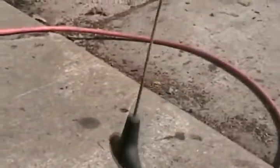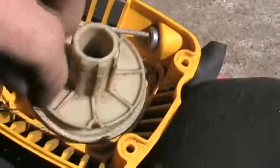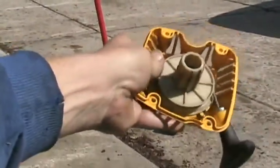Well, if it didn't wind itself back in far enough, grab a little bit more out of here, pull up the slack, hook the string back in the notch, and give it a couple more winds, then let go. Like this. There, it's all done. Perfect.